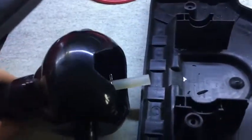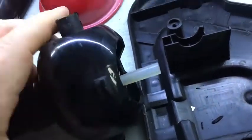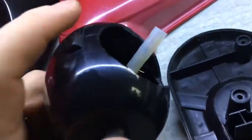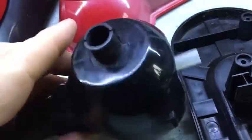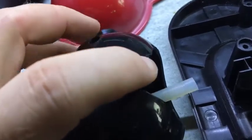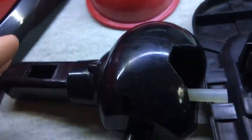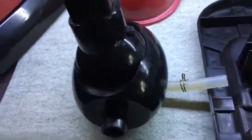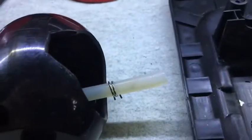My solution is to cut out a piece here on this fitting. It was curved like that but very high. On this side you can see where the line originally was — I cut about a centimeter out on that side. So when it swings around, the pipe has actually got a slot to go into, which means it's effectively giving it two centimeters more length on the pipe so it's not being pulled.